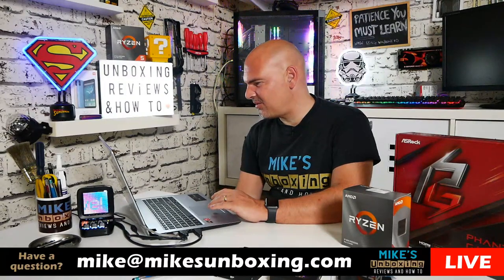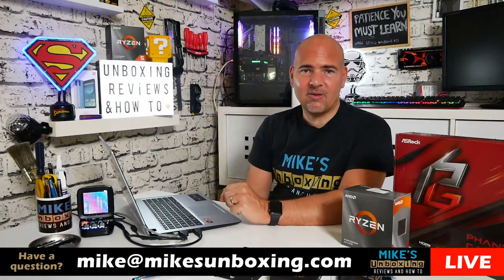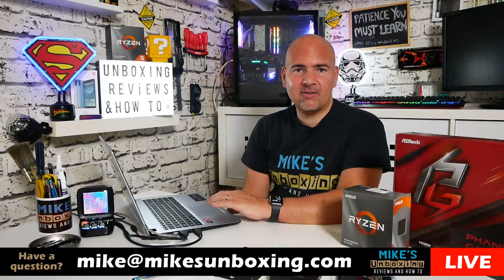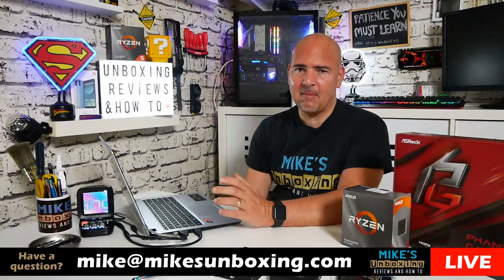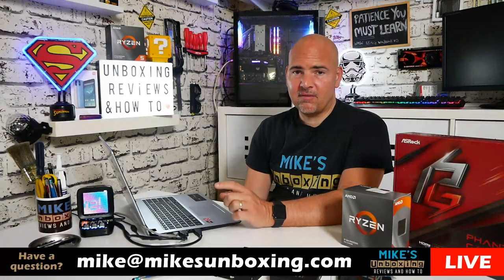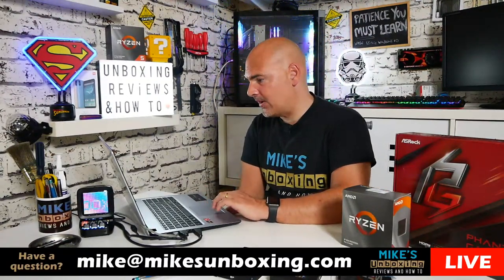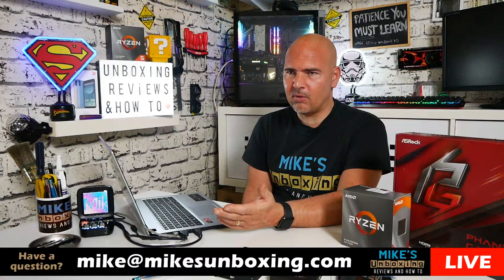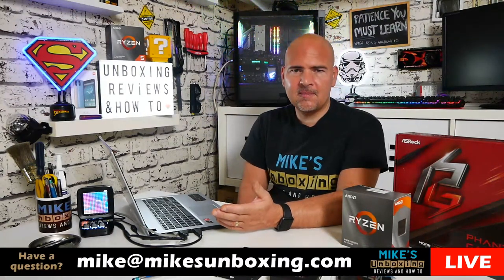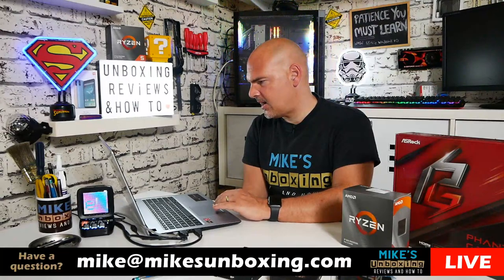Clinton Davis says, I just want to say thank you for the video the other day in regards to Snappy Driver Installer. It is like Lenovo system update for the masses. It really is useful. And actually, yeah, if you haven't tried or used that recently, Snappy Driver Installer. Now make sure you go to the right link, because there's been loads and loads of clones of the site that produce malware and all kinds of crap. So you don't want to do it, but it's snappy-driver-installer.org. Kaf's going to put a link in the description, so if you haven't tried it, give it a go, especially if you're getting errors, code 43s, you're getting random shutdowns. What was the one I saw the other day? Code 143 or something? The one where your system just randomly shuts down completely? That normally tends to be from a driver-related issue, so definitely worth checking that out.